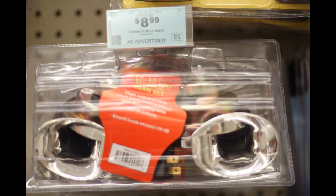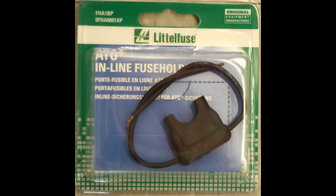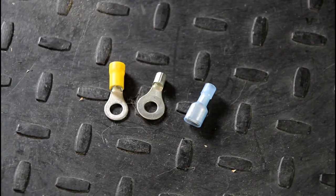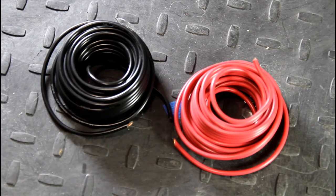Materials needed: a Harbor Freight pair of horns with 12-volt DC relay included, some cable ties, an inline blade-style fuse holder, 10-amp blade-style fuses, 14-gauge female spade-style terminal ends and terminal eyes, 14-gauge inline barrel splices, and red and black insulated 14-gauge wire — about two six-foot lengths.